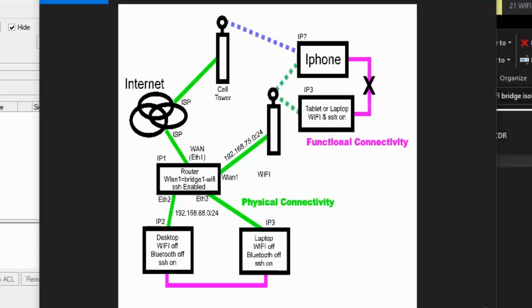In this lesson, we're going to show you how to create a second network so that the Wi-Fi users can all be on their own separate network. This network will be the default router network, 88. I'm going to create a 75 network just for these people. We're also going to disconnect their ability to talk to each other. So this will give security between the users on your Wi-Fi and keep the Wi-Fi out of your computers in your home. So let's get started and make this happen.